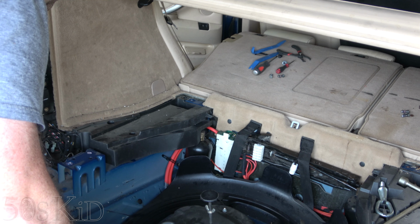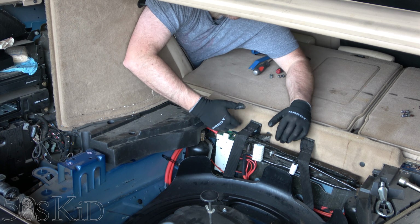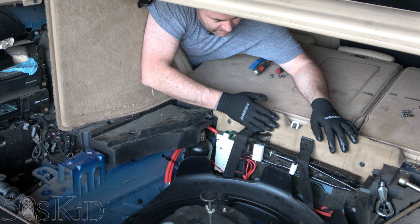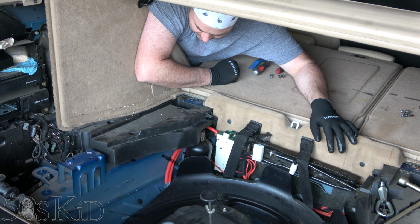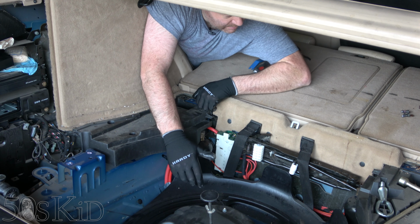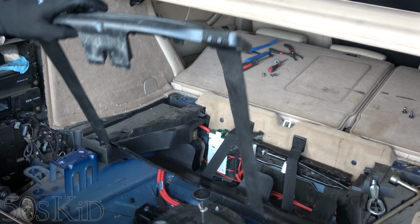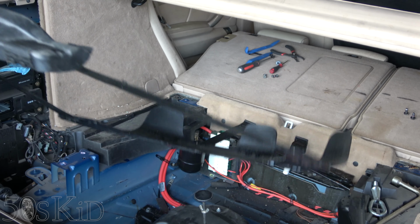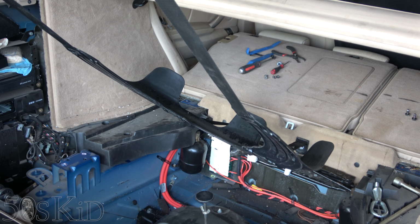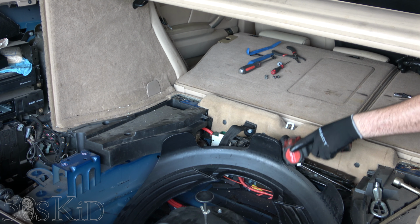Oh yeah, there's another fastener underneath this. So it looks like on mine, this one has to come out a little bit. Great. This stuff has to come out. Why did they do that? I don't get it. Why was that necessary? Oh, yeah. Looks like this car also has this spare tire lift tray kind of thing. And that needs to come out of there, those two bolts back there, before I can remove that trim. Those are 8mm Allens.